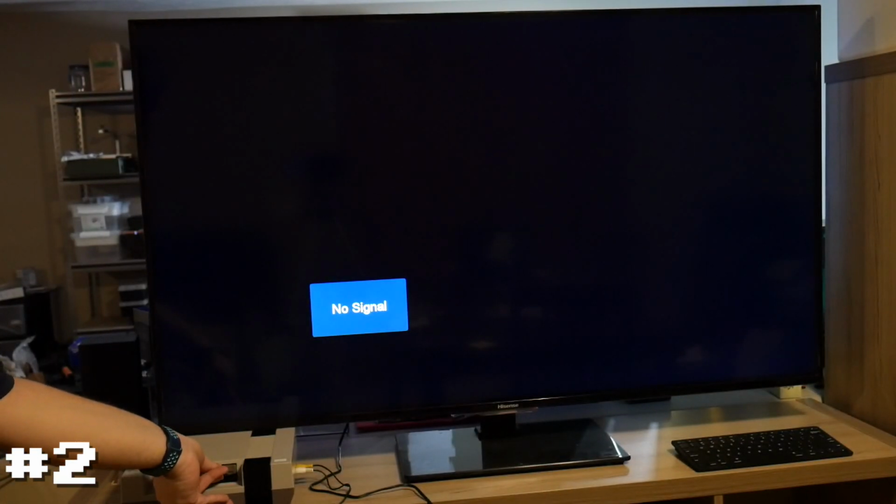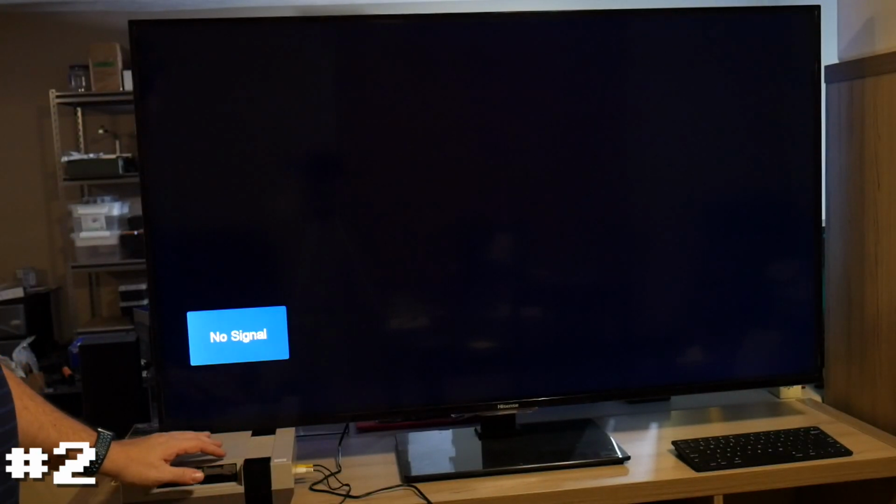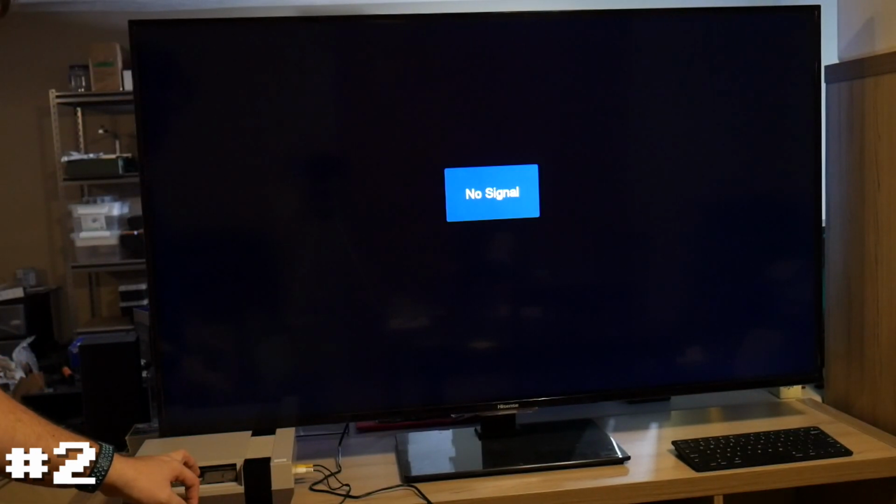Oh, wow. Okay, well, first of all, there is almost no grip, which you're not gonna be able to see on here. But this game just goes in and out of the connector like nothing. There's no grip to it at all. So my guess is, unless there's more wrong, at the very least we have to clean and rebend that connector clip. So let's test that out quick.